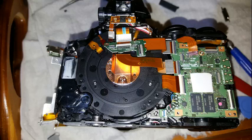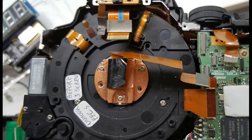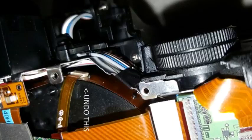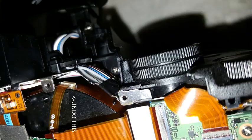If you want to work on the CCD, you can now see the three screws holding it. I found using a straw as a suction tube was a good way to pick up the IR filter — it is almost invisible so be careful. I prefer to remove the lens without removing the CCD sensor. Before removing the three screws that hold the lens inside the lens barrel, you must remove the two FFC leads to the focus and shutter assemblies. The focus FFC is about 3mm wide and goes up under the viewfinder mount. It is a push-in pull-out type connector, so with a good pair of tweezers I was able to remove that FFC. The shutter aperture FFC goes over the left side of the lens at 9 o'clock. It is not exactly the same type of connector as the others, so lift the flap on the opposite side to the FFC entry to release it. Free the FFC from the pin in the center so it is free to slide into the lens holder.